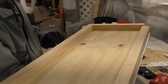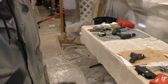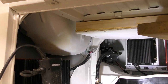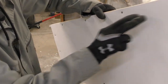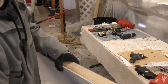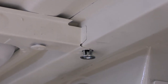What I'm going to do now is press the board up against the top part there using a jack to hold it in place while I drill the holes. Ultimately I'm going to drill holes in the corners and at midpoints — probably seven all the way around, about three in the front, two in the back, and one on each rear side. I'll use a jack to press it up against where I want it to be and then start drilling the holes. I got these holes widened out with my step bit to 5/16 so the jack nut can actually fit in there.